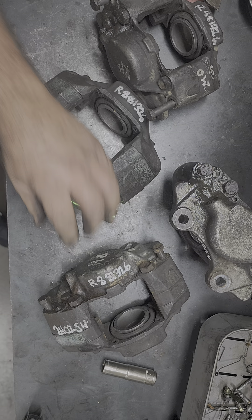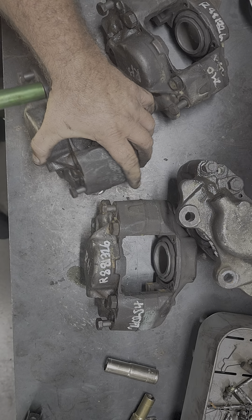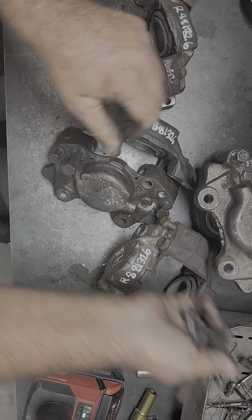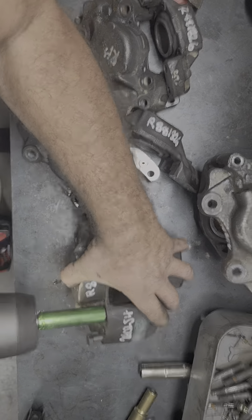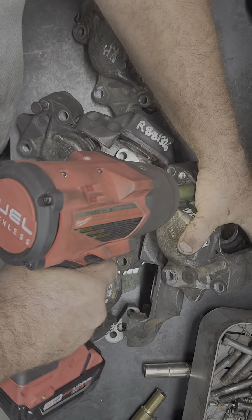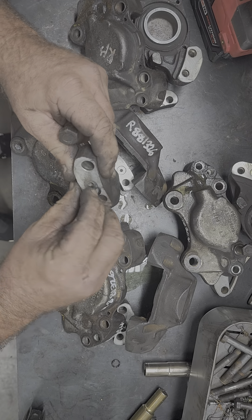That's garbage, we'll throw that out. Alright, so we got these small ones out, so now let's go for the bigger screw nuts, bolts. Throw everything in the pan — we're going to be putting those all in the parts tank, clean all the bolts inside out, just like that. The spacers, we're actually going to pull the little O-rings off of them, they're in both sides — get them out.